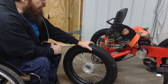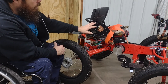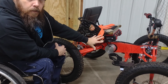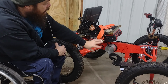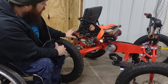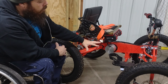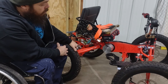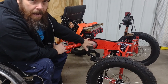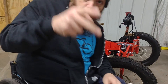The biggest thing we've had is my seating position. Right now I'm sitting a little high, but we have about 10 pounds of stuff sitting underneath the seat with only so much room. We have batteries, the controller, and part of the suspension. In order to bring this whole thing down about two inches, we barely have about three fingers of space between the battery and the bottom of the frame, so that is going to be a problem.